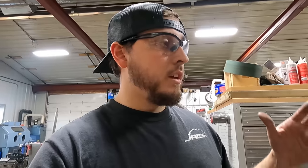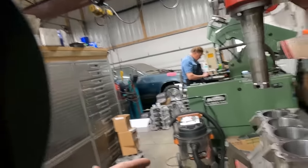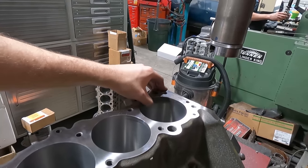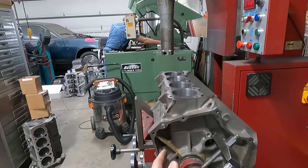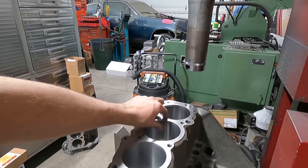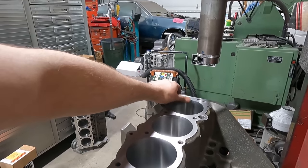There really wasn't a ton of wear in this block, but it was a few thousandths larger than we'd like if we were just going to put 30 thousandths pistons back in it. Our goal was to go to 40 thousandths pistons and square up the cylinders to the crankshaft — that's what our fixture does. On the first two cylinders I bored, you can see there's a little bit of a shadow left on the top two, probably due to misalignment from the last time this was bored — the cylinders were not bored perfectly perpendicular to the crankshaft centerline. When I put my bore gauge on those spots, they were around three thousandths from our finished bore size, so that's enough that when you hone it in the cylinder hone, it's still going to clean up and be fine.